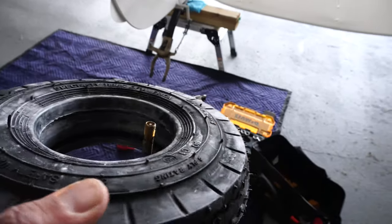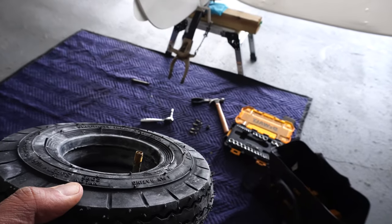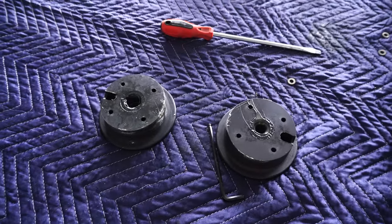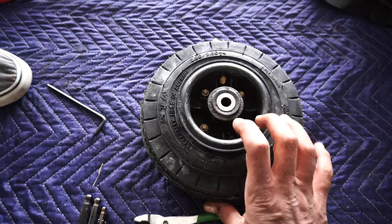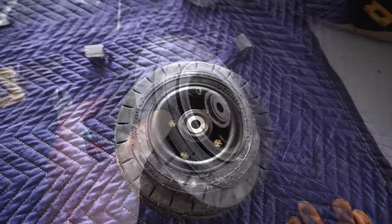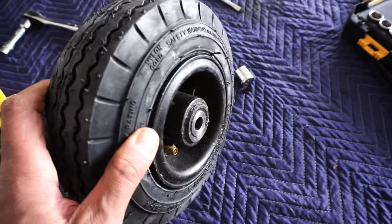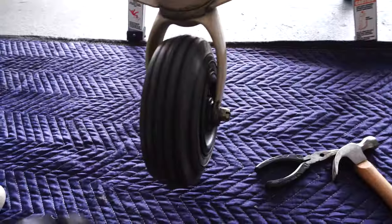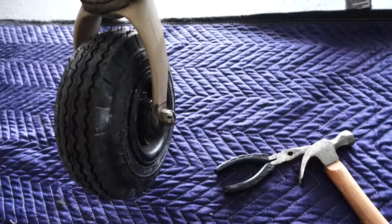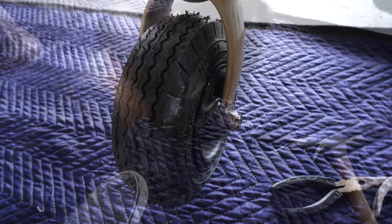We gave it a little bit of air so it's snug within the tire — not too snug, we may still need to move things around a bit, but we don't want it to be pinched in the hub. The tire is back on. We'll inflate it to the proper pressure — the tire has expanded and we're ready to put it back. New tire's back on. Now we're going to tighten the nut until it stops spinning, then release it a quarter turn to get a nice fit, and then we'll put the cotter pin back in.